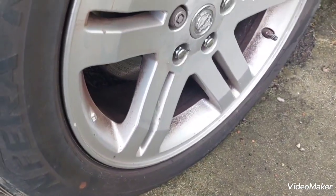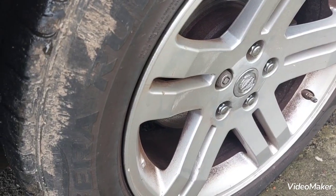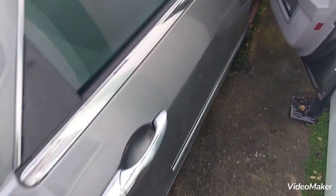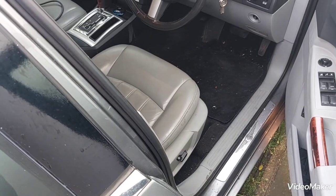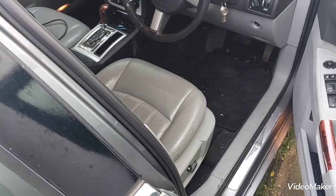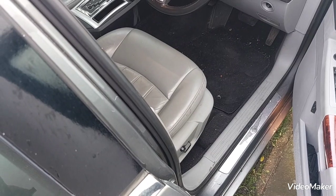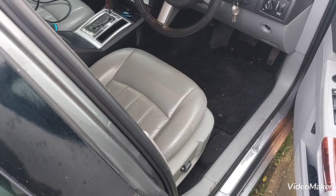I know the sensor is right, so the only other thing that it could be is the magnetic ring that is sending a magnetic signal towards the sensor, that is attached to the axle, that is faulty. On this age of vehicle, which is 2007, and now we are almost 2013, it's very likely to happen, because that ring has steel parts on it that can rust and break off, and then it doesn't work anymore.